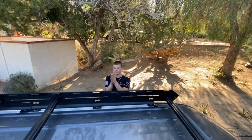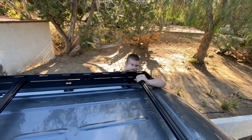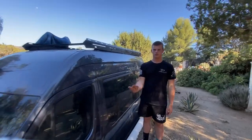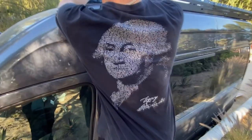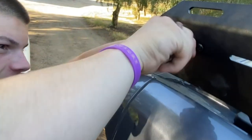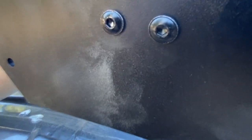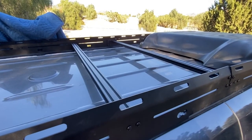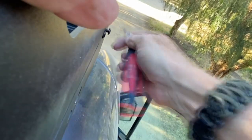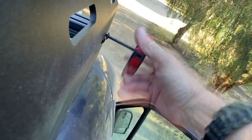There was a little error in shipping — no problem though. Throwing the bolt over the van — catch! Threading it in. Don't tighten them too tight at this stage. You'll see along these rails there are two bolts that are kind of close together — that's where you position the crossbars. Tighten these guys down, and if you're worried about them backing out, a little dab of Loctite blue — not the permanent stuff. Safety third.